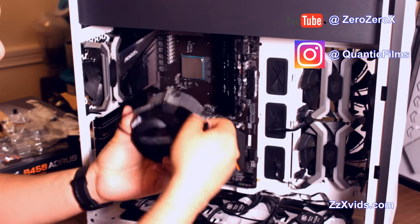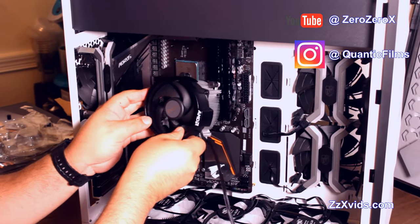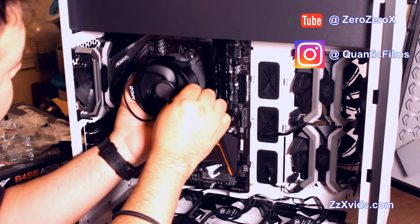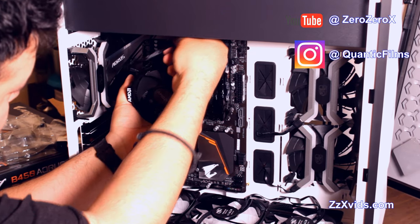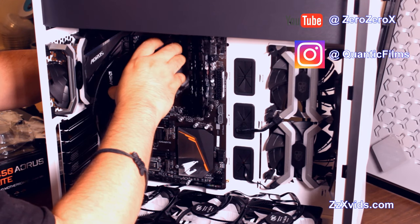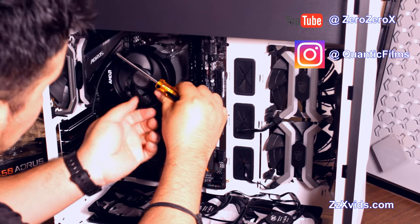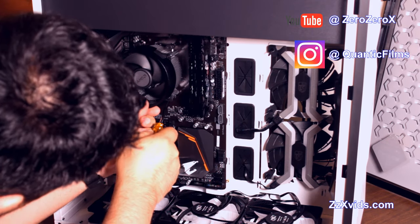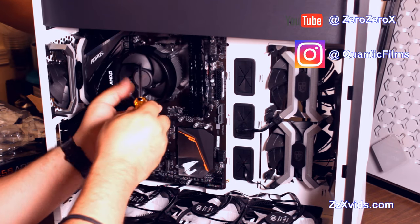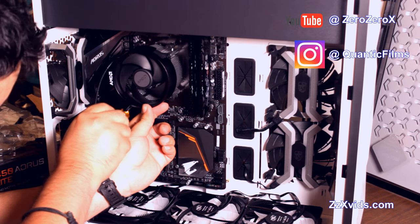Now there's two ways to install this cooler, this air cool fan and heat spreader. It has to be either this way, like this, because the screws are located in a rectangular fashion, or the other side, with the AMD letters heading the other way. There's only two ways to install this, really. We're going to install it this way, because it gives us plenty of space to connect the CPU fan header cable. The CPU fan connection is pretty safe, it won't be stretched or dangerous.